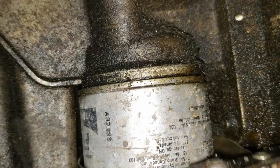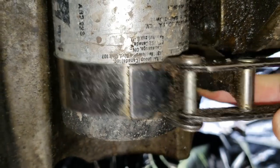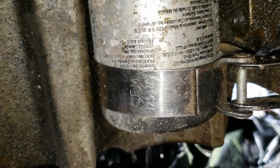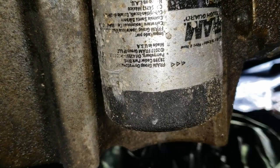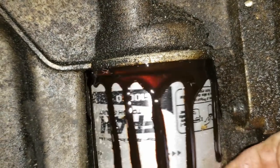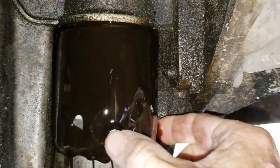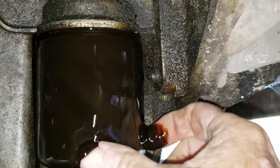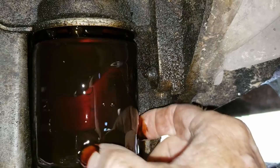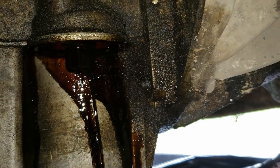It's a little slippery here because we drive in a lot of sand. I'm also doing it with one hand, but you can see it just starts to spin really easy. Once it starts to unscrew you can see the oil coming out. I think this is a major design flaw in the way Chevy put their things together, but it works. We unscrew the filter and let it drop down into our oil pan.